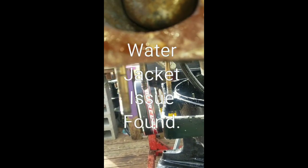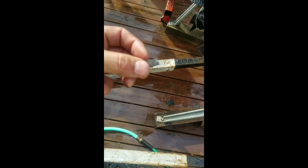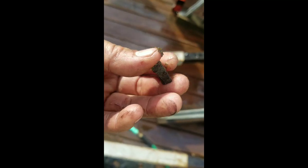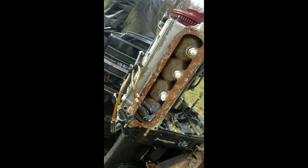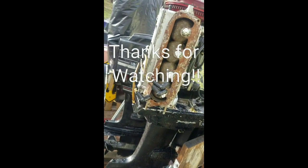All right, so I have found the problem. As suspected, that is a piece of the water pump impeller. When I rebuilt it, it was actually missing. I don't know if you can see that or not. Missing a blade. It was blocking the entire cooling system. All right. Well, guess I get some new gaskets, some new sealant, some new bolts, and seal this puppy back up. Should be good to go. Thanks for watching.